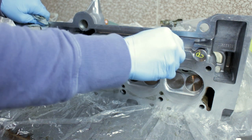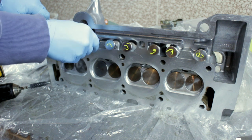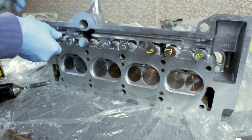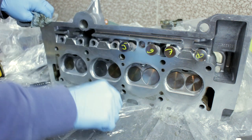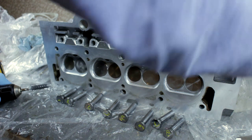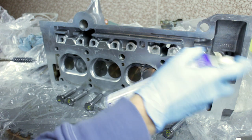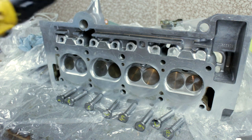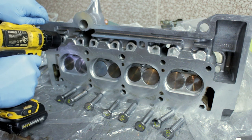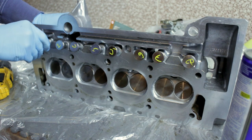It's already way better than before and this is just after a first pass. I'm going to keep doing this continuously until we can get them in really smoothly and to the correct depth. There's no play in any of these so I don't have to be careful about too much wear because the bore is really tight. It's working and I'm really happy with it. I'll add a bit more WD-40 and go to a bit higher speed on the drill — it seems to work much better and we've gotten a lot more progress.